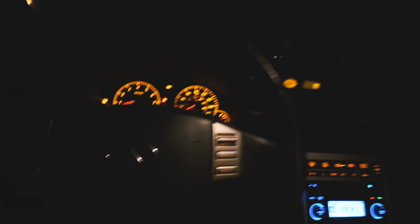We've been driving for about a couple minutes and as you can see, it is idling at around 30 PSI, which is good. And that's what we wanted to see. We've been running into a lot of issues with a connection and we checked continuity through the whole system and we found it to just be the connector on the actual pod. So that really blew, but we finally got it figured out. Everything's running good. And we definitely recommend it just to be able to check your oil pressure on your car, because it's a common failure, and on top of that, this car doesn't have it, but the Z's do. So that's something that I definitely recommend.